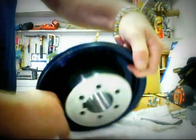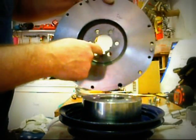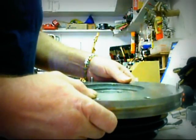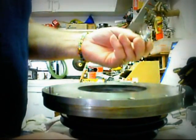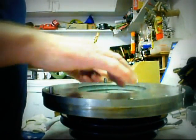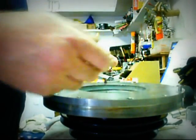I've turned this upside down, and we're going to put this part on. You can see how this is keyed out — see how that keyhole is cut in there? Well, that's going to have to match up with this keyhole here. Once you put this on, you put your bolts in with lock tight in each of the holes, and then put each of these in hand tight. Then you put the whole thing onto the shaft of the motor before you tighten everything up. Otherwise you might tighten everything up and it won't fit on the shaft because of the tight clearances.